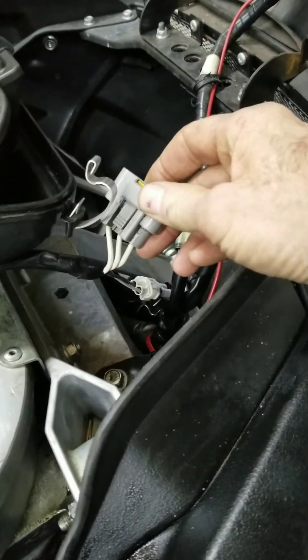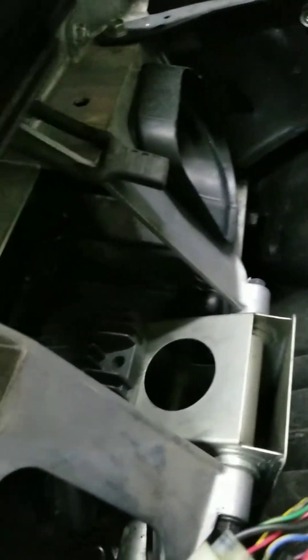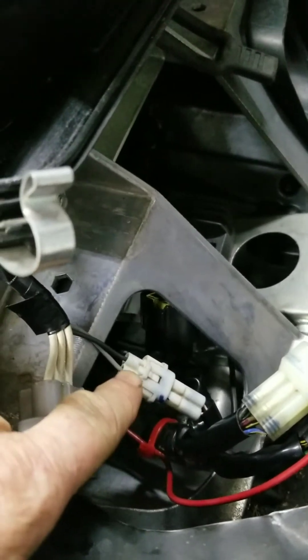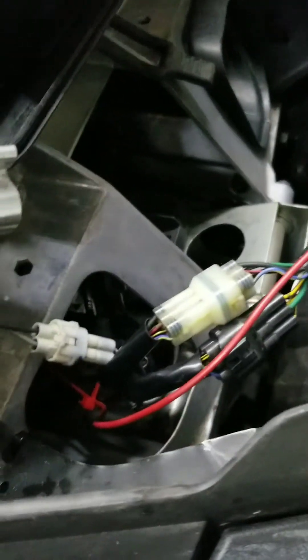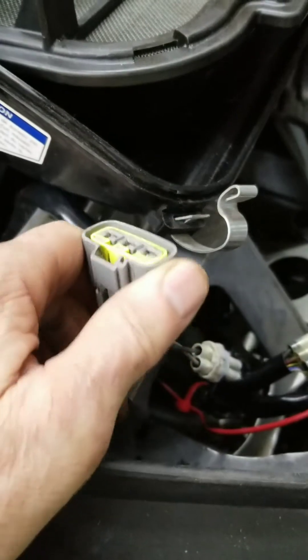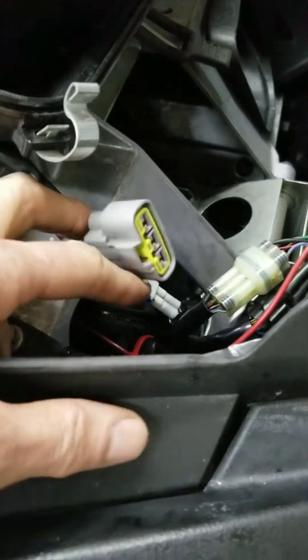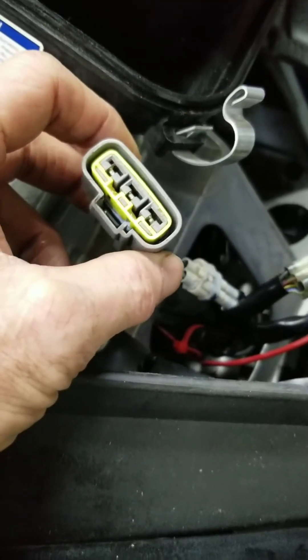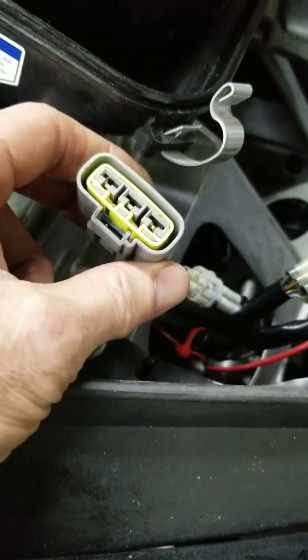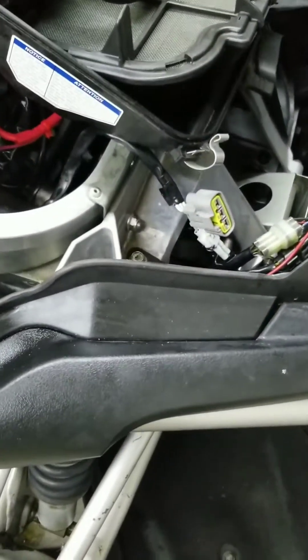The gray connector with the three wires is coming right out of the engine from the stator. I started the machine without the voltage regulator connected because it's outputting nothing, but you have to have the other connector connected because that connects the instrument pod and it won't start without it. With that connected and the stator disconnected, measuring AC voltage from each pin — the stator has three phases, each white wire is one phase. At around 2,000 RPM I was getting 40 volts out of one phase; the other two were like 8 and 14, really low. So I suspect one phase was gone and the other just failed, so there's not enough to charge.